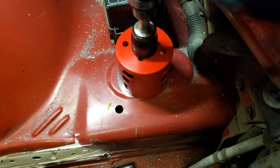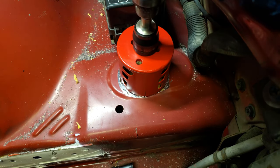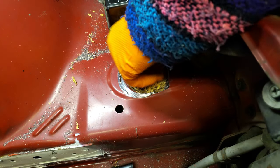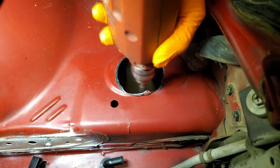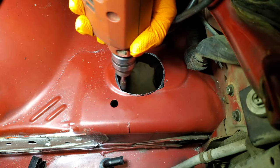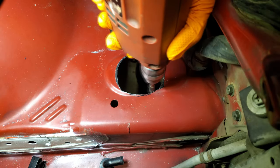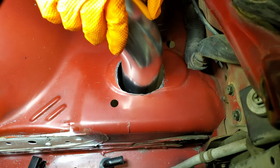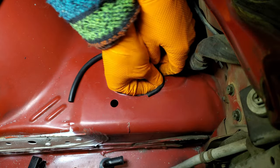This was at least the theory of operation, and it worked out somewhat well. You might try and find some better ways to do this because it didn't turn out as nice as we'd hoped. In the end, we had to go in with a carbide bit to kind of clean up the edges as best as we could. Those edges will need to get finished up with some paint to keep things from rusting, and then we also went ahead and used some vacuum line cut in half to act as a grommet to keep our intercooler piping from touching the edges.